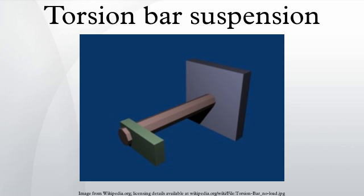Some front-wheel drive automobiles use a related type of torsion beam suspension, usually called a twist-beam rear suspension, in which the rear wheels are carried on trailing arms connected by a laterally mounted torsion beam. The torsion beam functions both as a wheel-locating arm and as an anti-roll bar to resist lateral motion of the wheels as the body leans and turns. Its advantages are that it is inexpensive to manufacture and install, and engages a minimum amount of interior volume, leaving more space for the carriage of passengers, cargo, and other components. Because the torsion beam acts in the lateral plane, not vertically, the twist-beam axle cannot provide ride height adjustment, and it suffers, to some extent, similar handling limitations as other beam axle suspensions. However, these limitations may not be apparent on the road because of the trend towards firmer, more sporty suspension setups with more limited wheel travel.